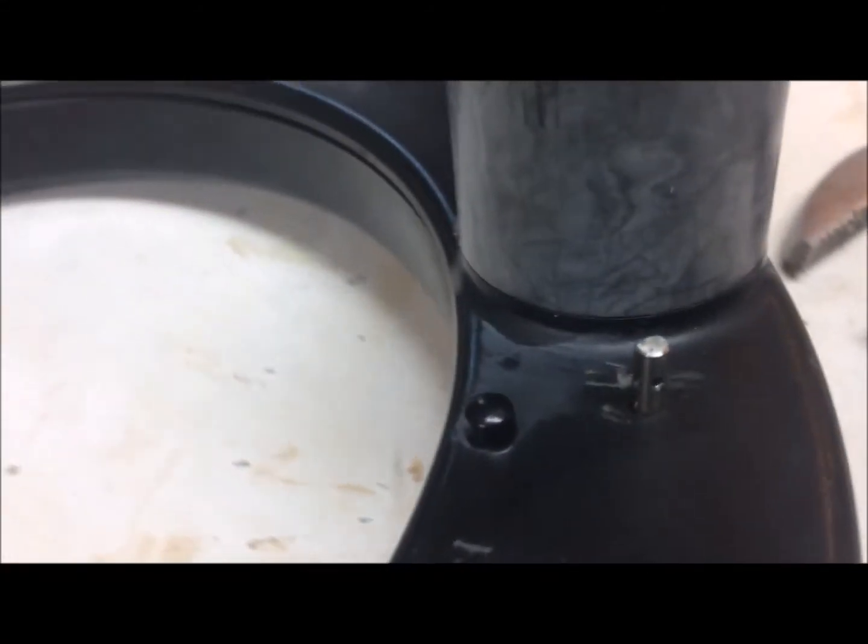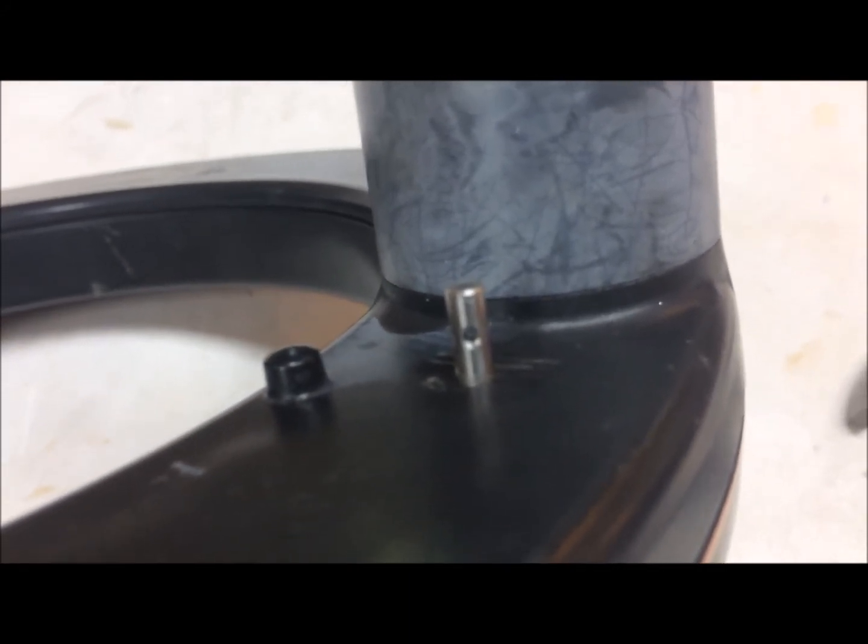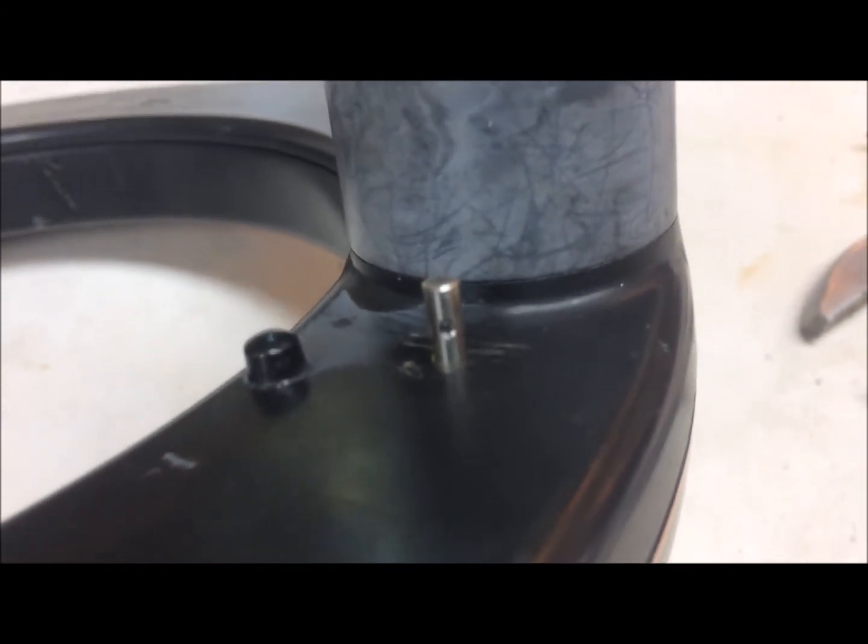The first thing to do is check to make sure that the roll pin hole in the side of your D-shaft is still nice and round. If it's not, drill it out with a 1/16th inch bit, or preferably a 1.5mm bit. Drill slowly and carefully until you're sure that hole is round.